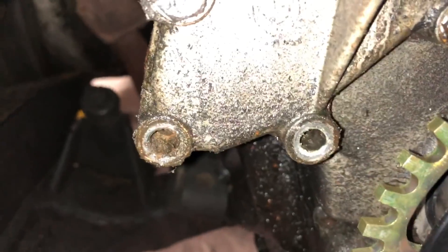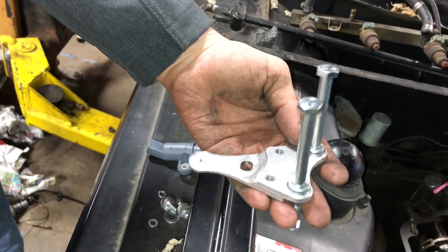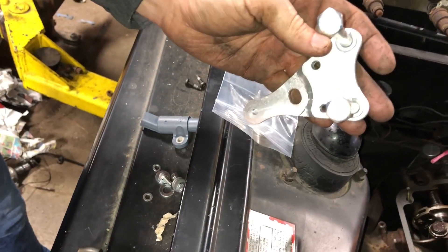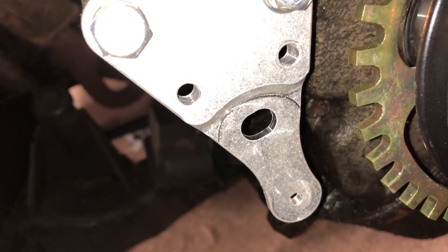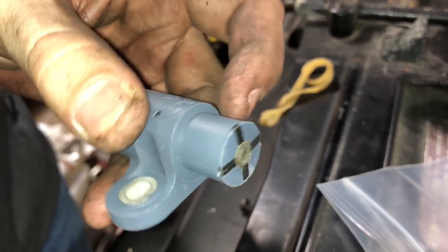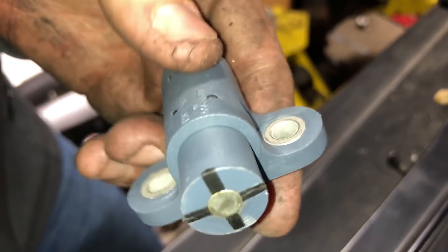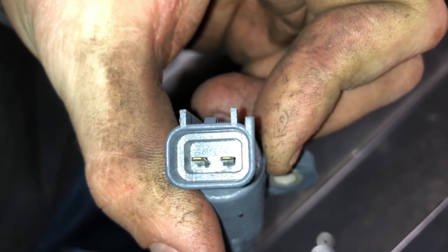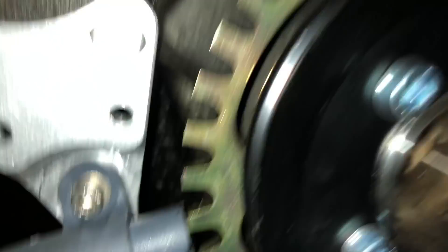So the reluctor piece goes right in there. I took out the original two bolts and we have a gorgeous billet piece with two new longer bolts. Down here there's a fixed screw hole and a variable screw hole — that's going to allow us to get the VR sensor tip within ideally two tenths of a millimeter, maybe three tenths of a millimeter from the crank wheel. You really do need that for optimal resolution, as I learned on the Mercedes project where I could sort of get it to crank and fire but not entirely until I got that distance well down. This is a variable reluctance type sensor — it's not a hall effect, so it's not quite as forgiving.